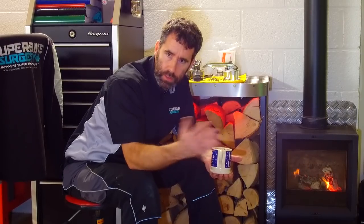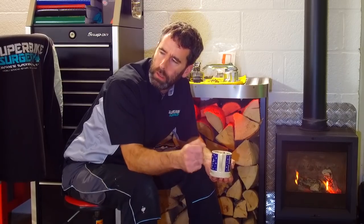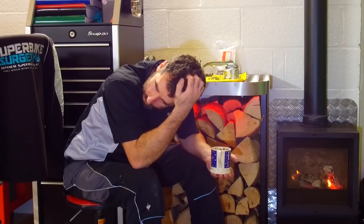Riding along, these are the symptoms. Obviously the title of the video is giving away what the video is about, but I get this phone call a lot. Riding along, the bike cut out, went to restart it, the dashboard's doing weird things, and I get a funny clicking noise from underneath my seat. So those are the symptoms. The symptom is a flat battery.